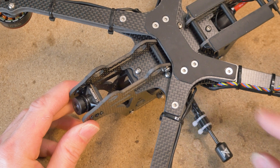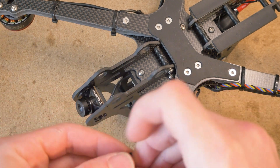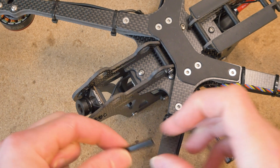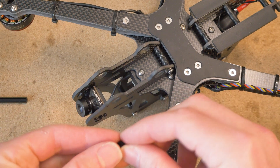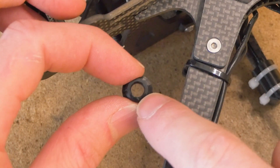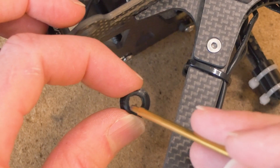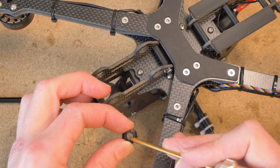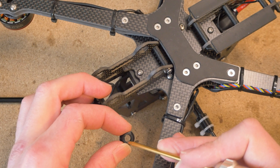On my seven inch vulture prototype, my camera mount was extremely loose and I could definitely see jiggles in the footage. So I 3D printed some tighter bushings — these happen to be 5.3 millimeter, though that may not be correct for you since my standoffs are a little thinner because they're from Amazon rather than my regular supplier. I printed these custom bushings out of polypropylene. You can also use TPU, as long as the inner circle is nice and round — any blobs or zits on the internal perimeter will cause issues with sliding and reducing play. One trick for 3D printing to get a smoother surface: increase your fan speed for external perimeters and keep fan speed lower for internal perimeters to maintain strength.